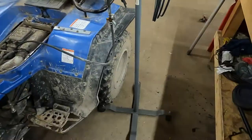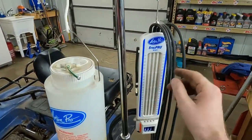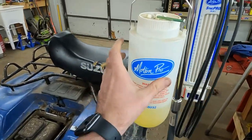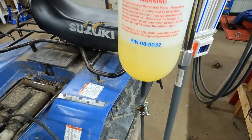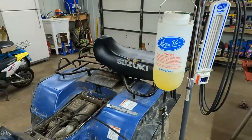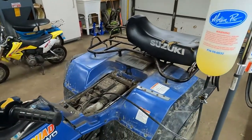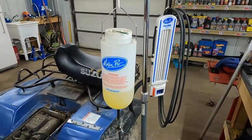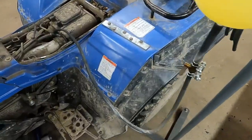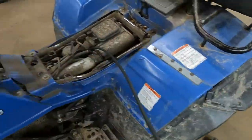I've pieced together this little umbilical tank setup — it's kind of like an IV stand. Off the sides I have Motion Pro sync sticks, which work really well. I've also got the Motion Pro umbilical tank, which is awesome — you can adjust how high it goes, so if you're working on something taller you can still get the fuel height to run downhill into whatever you're trying to start. I've got everything hooked up and ran the fuel line into the carburetor and turned the valve on.